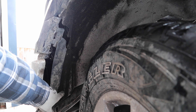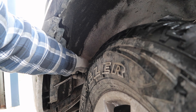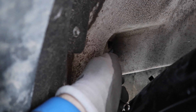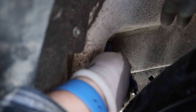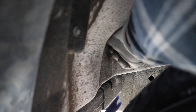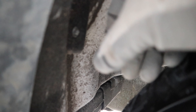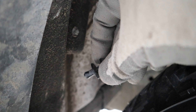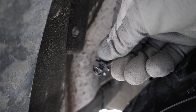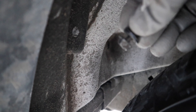Let's get the three bolts and the one clip out. The three bolts in question are one here, one here, and one right up here. Get these three out, and then deep inside here there's actually a clip — you can see up in here, there is a little plastic clip. You pop it out, give it a twist, and it just looks like that. Pretty standard clip. So let's get these bolts out and the inner fender well dropped down.